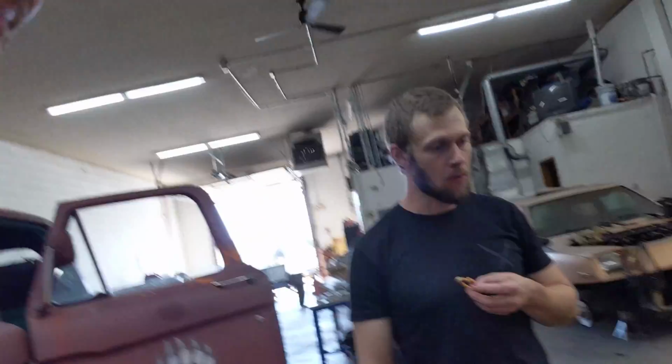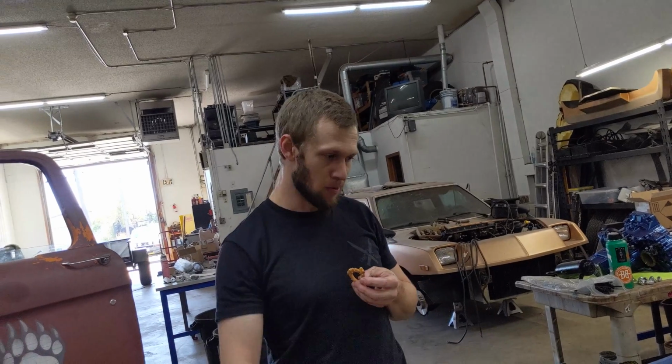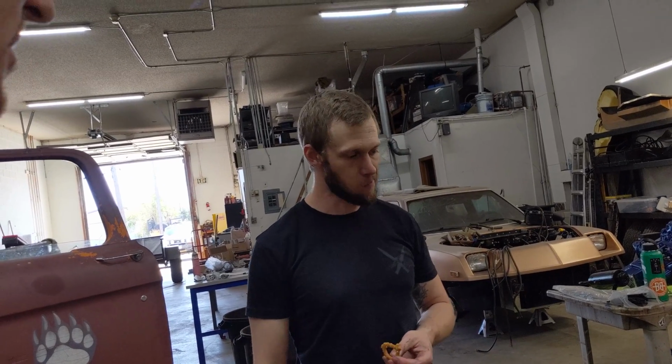Yeah, mainly new seals. Just gonna get a new Birfield, touch the axle, seal it back up. Seals on the back side, seals on the front side. All back together. Should be good. And then the other side we'll basically just do seals and gaskets because all the parts look good. We'll just get new grease on there.